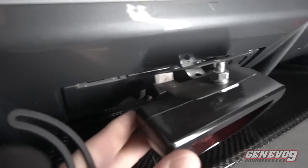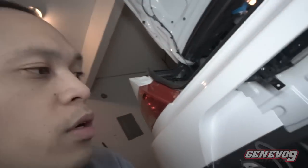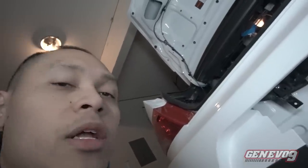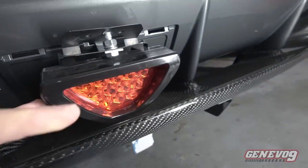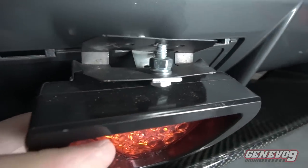Did a custom bend so that it goes right through that mini hole. So again, on the Evos, you have to take out that plate on the JDM bumper for that to work, so it'll slide right through, because there's a little tiny hole where that bracket piece fits up to the bumper, and when you take out that plate, there's actually going to be an exposed hole to the bumper for your advantage. I slid it right through there and pretty much attached it to the F1 brake light with some screws,